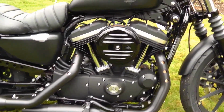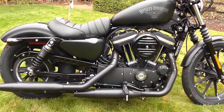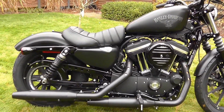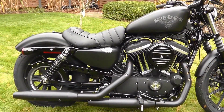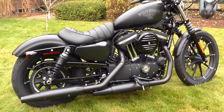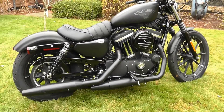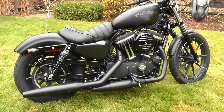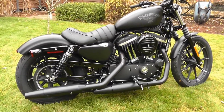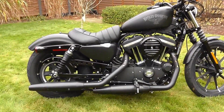The part number for the 2016 exhaust pipes is not the same as the part number for the 2015 and back. It's a whole new different number, and I'm thinking that if you wanted to order some pipes from a 16 and put them on a 15, I don't think it's going to bolt up properly. I talked to a couple of the shop parts guys, and they seem to have the same idea about it, but we were not sure.